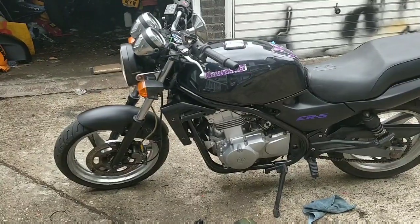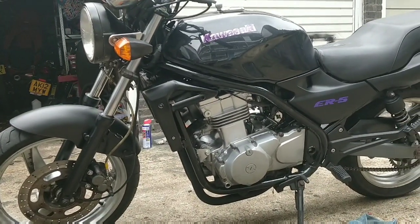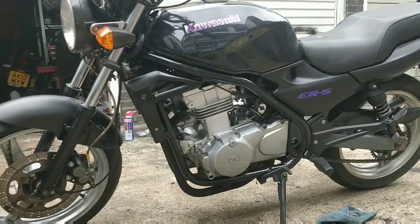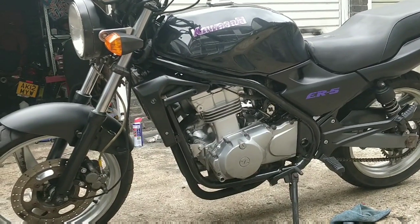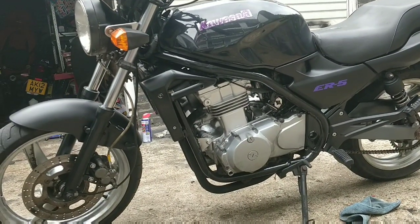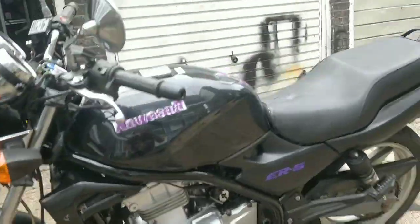So that test ride's over. The bike cut out abruptly twice. It feels like a fuel starvation problem. The bike idles all day long - leave it alone and it will idle all day - but when you're moving along it almost loses power. You don't see any gradual power loss; it just abruptly cuts out, normally on around half to full throttle. It kind of bogs and cuts.